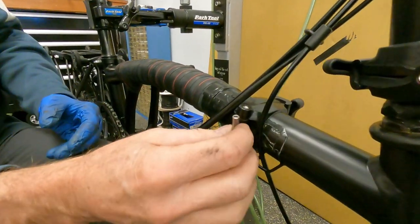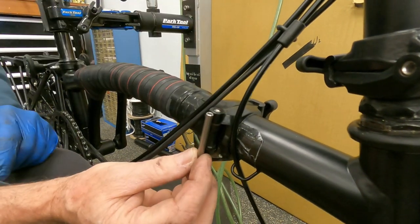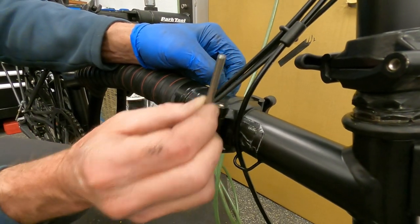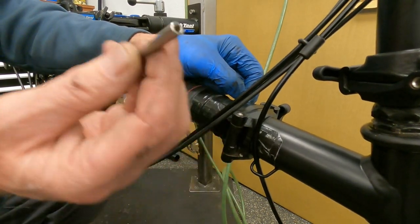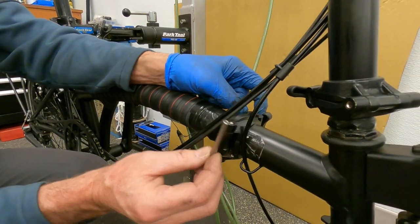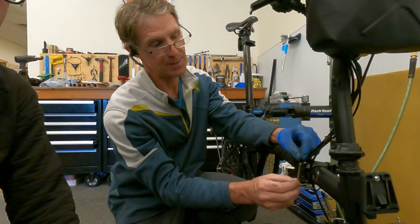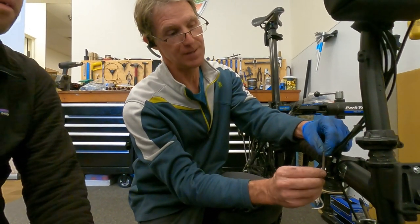This pin is inside the frame there, and what we're going to do is drill out from the bottom and then push the pin out through the top of the frame. We're going to put a new pin in to see if that's going to solve the problem, if the wear is on the pin itself. If the wear is on the metal of the hinges on the main frame of the bike, then we're going to have to get one of the oversized pins.